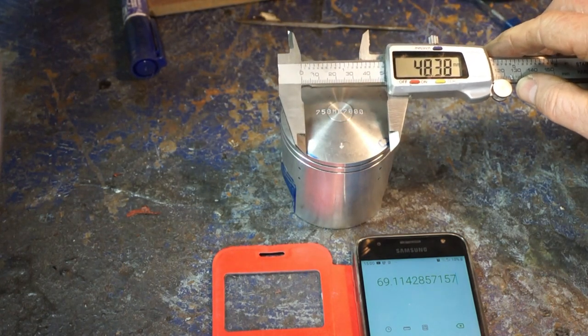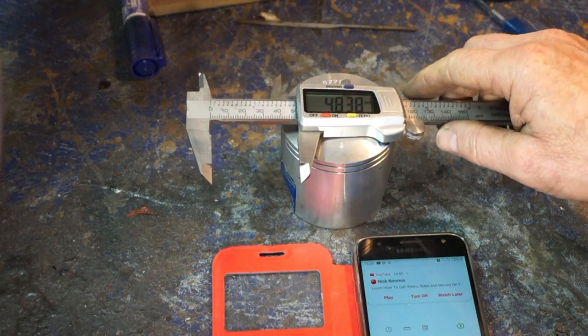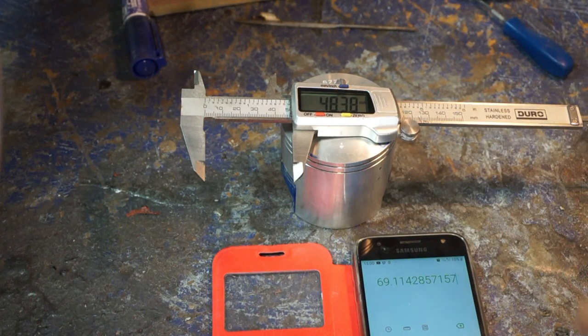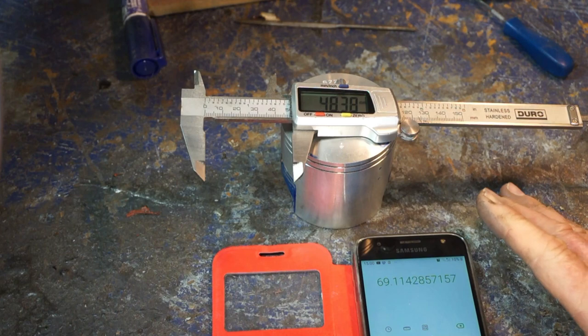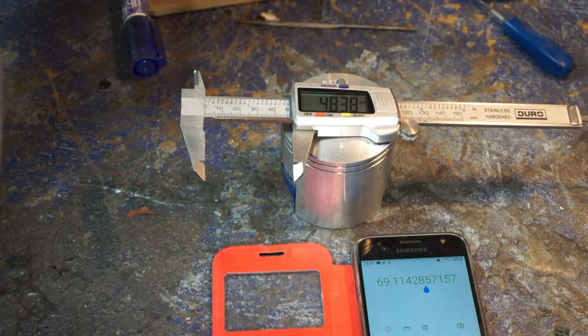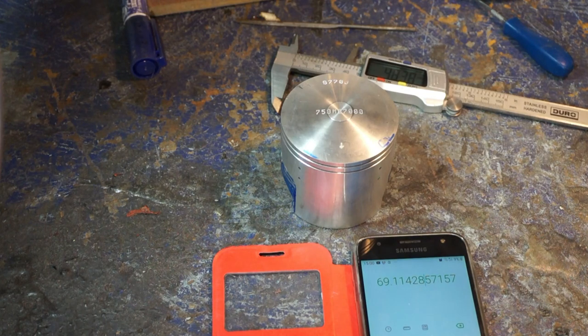Okay, we've measured the piston on the points that I marked out at our widest point, and we got 48.38 millimeters. So chordal width, that works out to be 69.1 percent of bore, 69% of bore. So that's pretty wide. The reason I can get away with that is because of the shape of my port, because it's easier on the rings. And a big thanks there to one of my subscribers who's sending me some 3-bond over. You know who you are. Big thanks goes out to you, my friend.